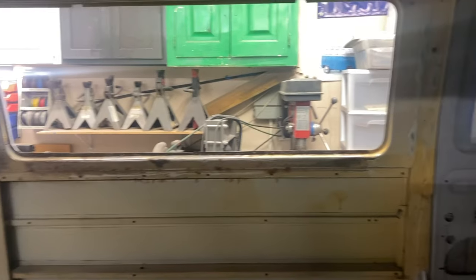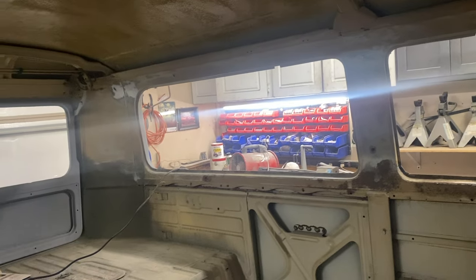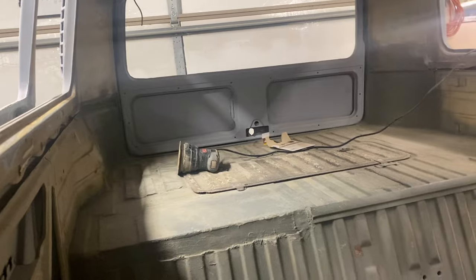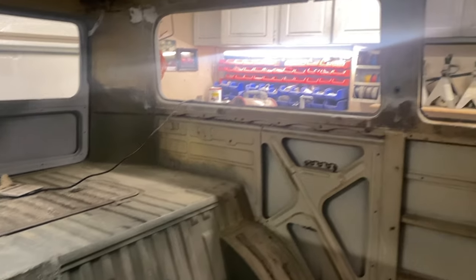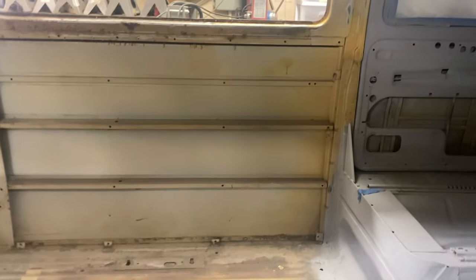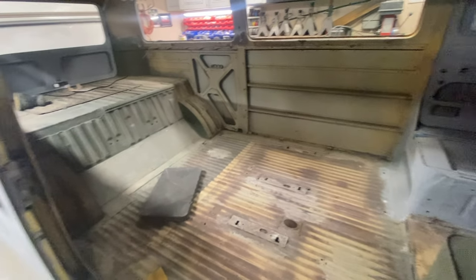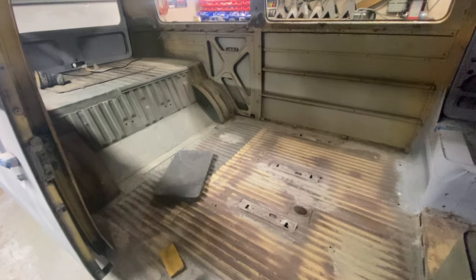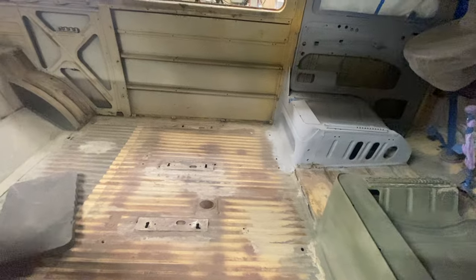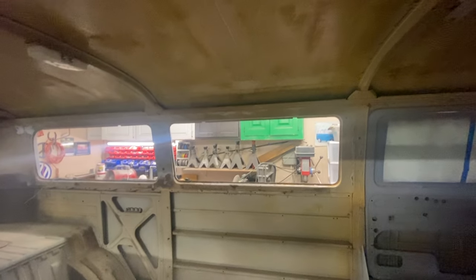What I've been doing is sanding all the places that I think may show when I paint the red paint inside. I'm getting a lot of adhesive off of it. It's going to take a little while to get as clean as I want it before I spray it. All the areas that are going to show are going to have to be sanded, and the areas that aren't going to show I'm probably going to tape off and paint with the red oxide Rust-Oleum paint to prevent rusting on heavily corroded metal.